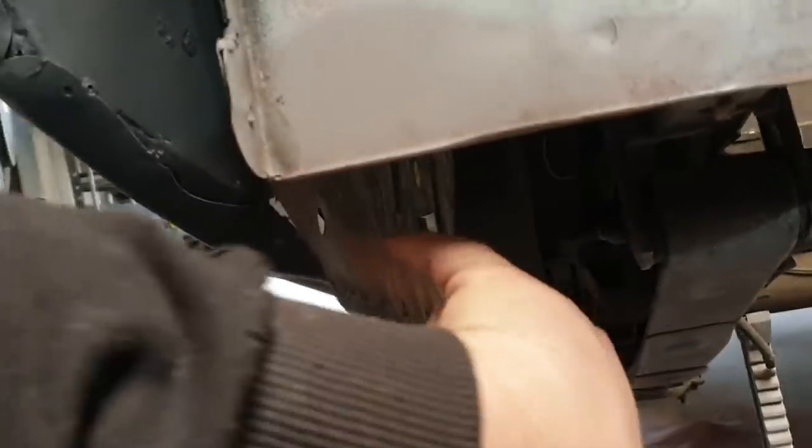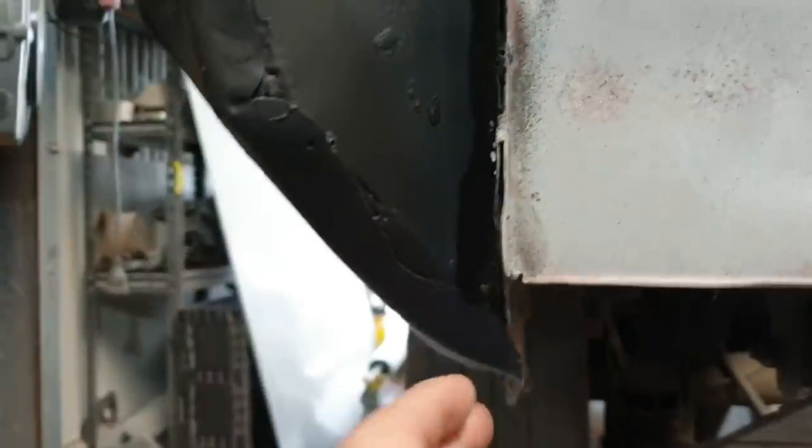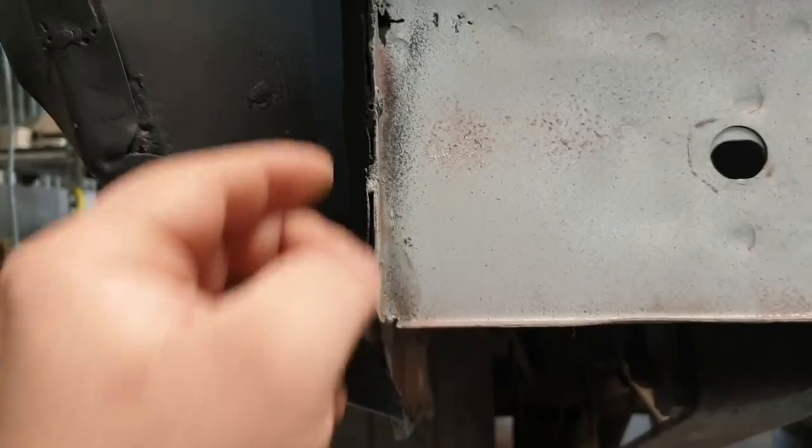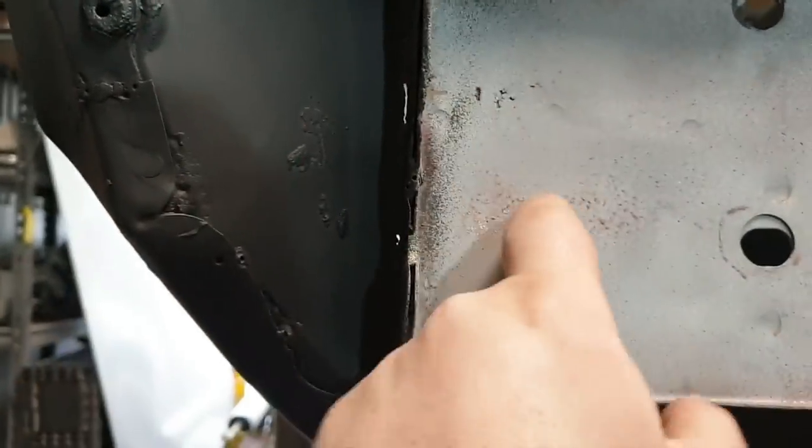As long as you don't cut into the inner lower rear quarter, because if it's done right, or if the factory has done it, it will be in between this panel and this panel. So there are three layers just here. Unfortunately, I'm going to have a nightmare getting this off, because somebody's been here before. This side's all plug welded, whether or not those plug welds are actually holding is another question. So I'm going to have to cut across here, and probably these ones have to be belt sanded, and then I'll cut, pull this panel out, then get my new one.